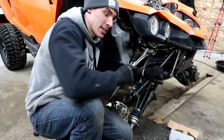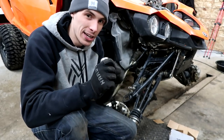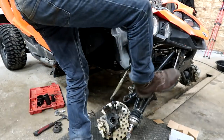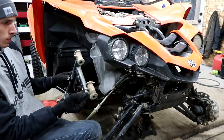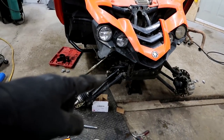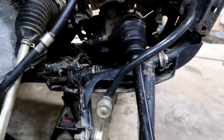I can no longer put my left wrist on a hard bolt that can release quickly. I don't want to risk that because once that nut or bolt gives, it hurts so bad. So I got to go about this like a monkey. Right now it doesn't hurt at all — I'm doing the use-it-or-lose-it slash don't-use-it, about 50-50. This lower one's loose. Unfortunately I have to remove the skid plate in order to get the lower control arms off on both sides. If I hadn't put that little plastic notch on the skid plate I wouldn't even have to take it off, but since I did, I'm ripping it off.